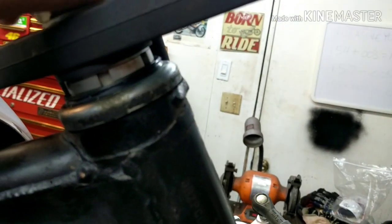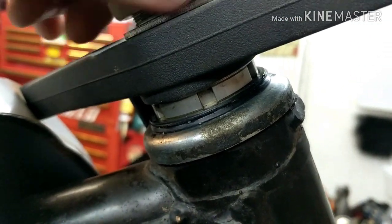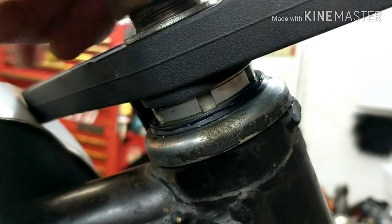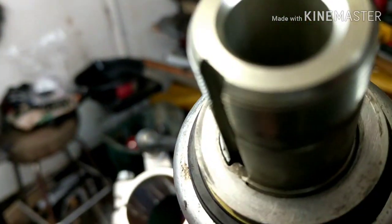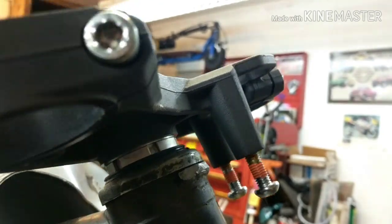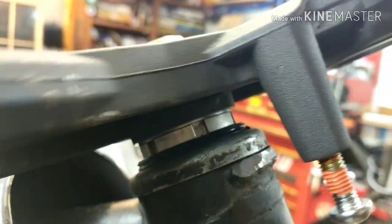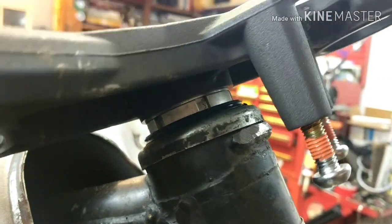And with that on there, okay, I put the lock washer over the nut. So instead of having 2 lock nuts on there, because there's just not enough room, I put this lock washer, and this lock washer has a little tab right there. All right, so what that does is when this rotates, when the whole triple, just down here, when this whole triple rotates, this can turn separately, and it won't turn the nut at all, because that washer is in between the two, and the washer is going to stay in place. So this can slide on the washer and it won't loosen it.